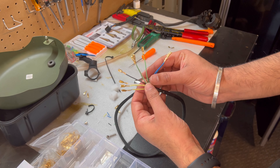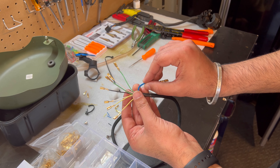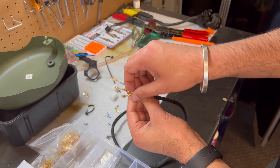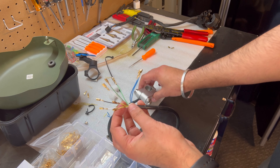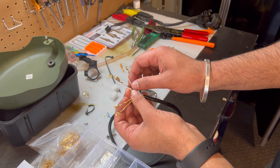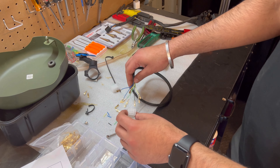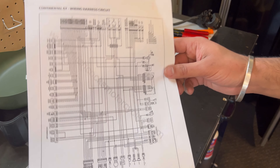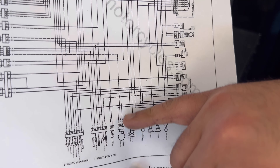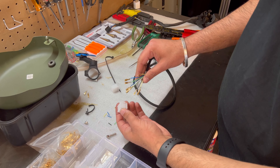I got the left switch with all the connectors fitted. A quick overview of the wires: the blues are for your horn, greens are for your high beam, yellows are for the button on the back, and whites are for your turn signal - it doesn't matter, you can connect left-right or right-to-left. Black is for the flashing. To assemble on this nine-slotted plug you can follow a diagram available for the GT in your vehicle service manual to track down the headlight wiring.